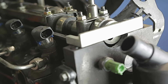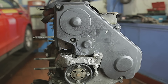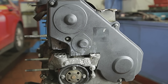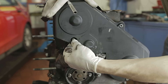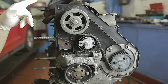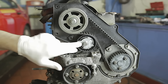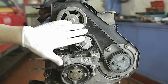To remove the top cover - you've got one 10mm and three 8mm bolts - so I'll knock all these out and off comes your cover. If I were just replacing this top belt by itself, I would just paint mark the sprockets, the pump and the camshaft sprocket to the back casing. I wouldn't remove the top cover, I wouldn't fit the setting plate, and I wouldn't fit the crankshaft pin. I'd just paint mark the two sprockets to the back plate, undo the tensioner, take the belt off, put a new belt on and it'll be fine.